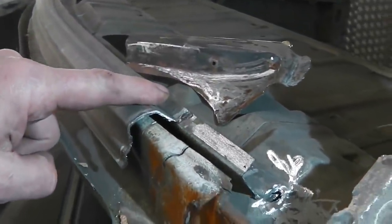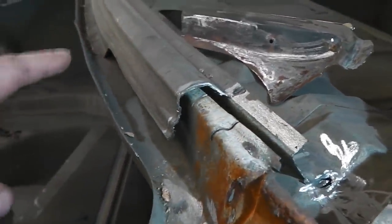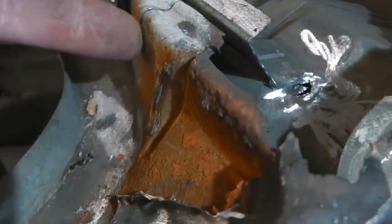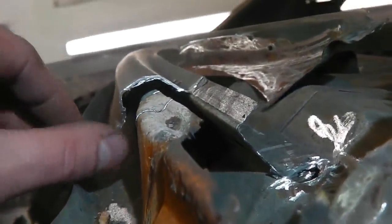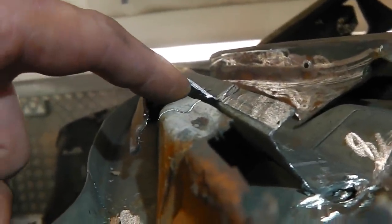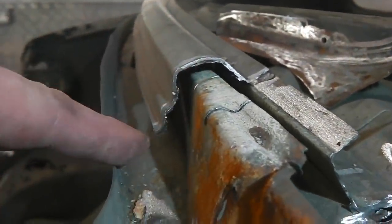There's your back window rubber seal. So on the face of it, looks straightforward. Some air ducts, but the air ducts are working in conjunction with the gutter. The gutter continues up, and you can see there that it creates a hole at the top. So there isn't actually a point where this is sealed. It's actually allowing air to come over the top and out.